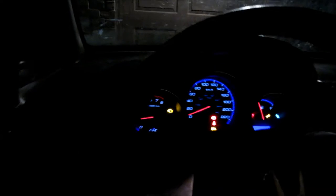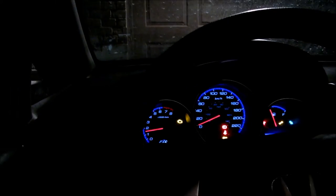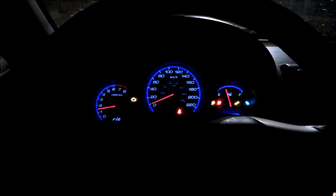I was just pumping the brakes because it felt soft at first when I was pressing on them — I had compressed the caliper piston on the brakes with a C-clamp so that I could get the brake caliper back on. Anyways, let's go take her for a ride. Let's see if I can stop.